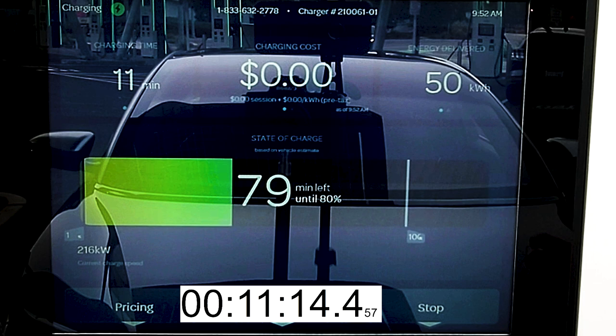That's actually half the size of a Tesla Model S battery pack. When I supercharged the Model S, it took 15 minutes to add 50 kilowatt hours. The Porsche Taycan took me 23 minutes to add 50 kilowatt hours. You also have to consider that the Air is more efficient than both of those vehicles — so not only did you add 50 kilowatt hours in less time, but the Air can go further than those two electric vehicles on 50 kilowatt hours.